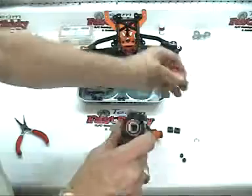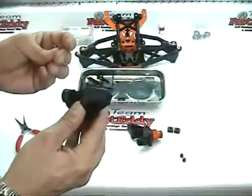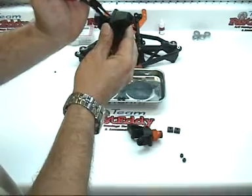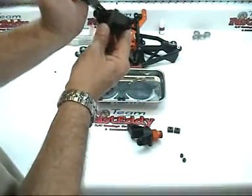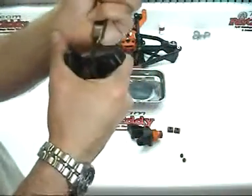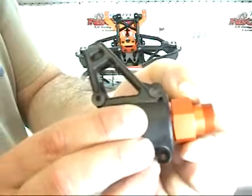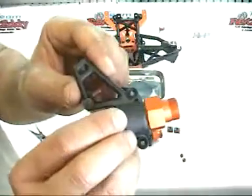Let's go ahead and insert the second one — drop that in and flip it over. We're going to look at our c-clip to see which is the rounded side and which is the jagged side. We're going to put the rounded side down against the bearing. Go ahead and use our needle nose and pop that c-clip on just like so. Spin it to make sure that it's locked in there and seated all the way down — which it is, it spins freely. We do have an amount of play — we're going to go ahead and shim that out later on in a separate tutorial. If you do have a package of Team Fast Eddy shims, now is a great time to do it.